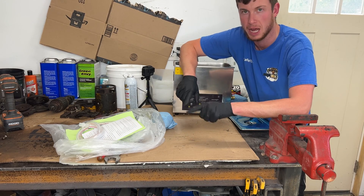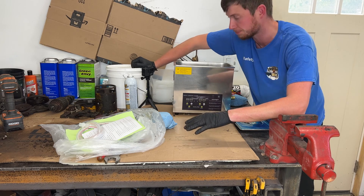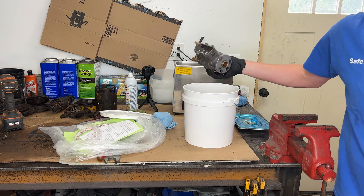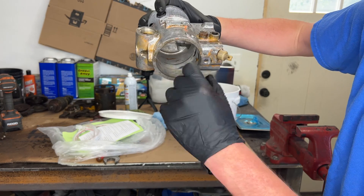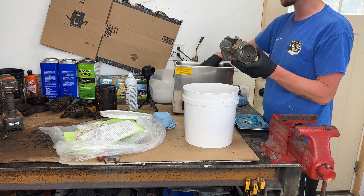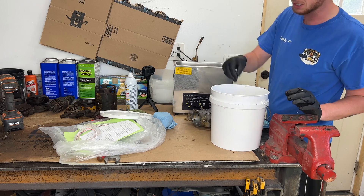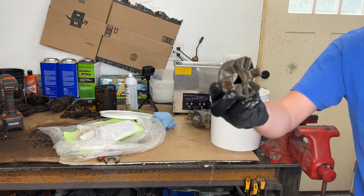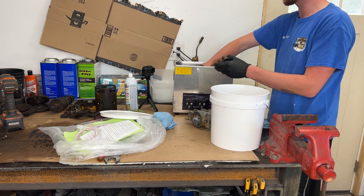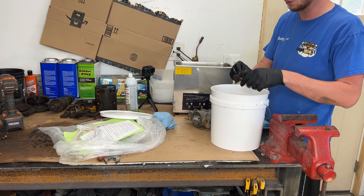Nothing really worked, but I noticed one thing — it's pretty hot, about 95 degrees out. So I put the bucket and the one with the Simple Green outside and I actually saw the stuff started to wear away. That told me that the key to this is going to be heat. Everything is starting to look pretty good but there's still stuff that wipes away with my finger. Since there are a lot of little ports and passages in here, I really don't want to do that manually. So I went ahead and bought this ultrasonic cleaner — I'll put a link in the description. It's going to give us agitation, but more importantly it's going to heat everything up, which is important.